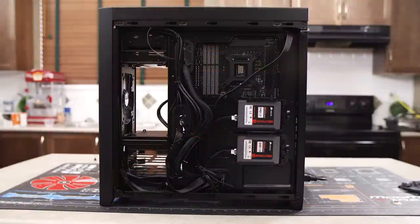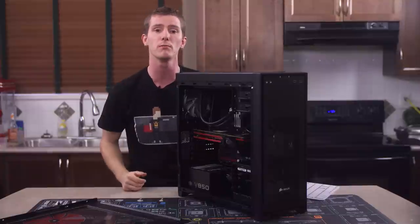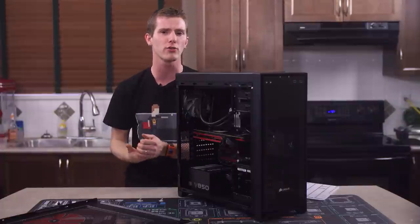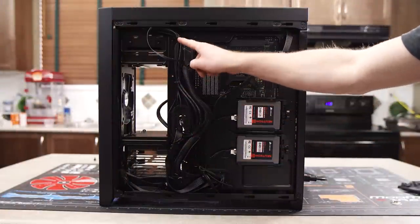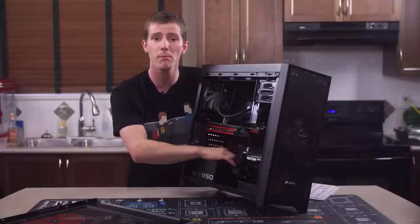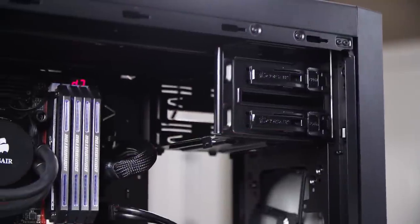Cable management is a good point for this case - there is ample room in the back for the 24-pin and other bulky connectors, and the included cables for the front panel actually come pre-managed with zip ties tied in place, so you pretty much don't have to move them. But note that I said cable management is a good point, not a great one. The back of the motherboard tray has only four cable management loops, and when they're basically free to add, I'd like to see a lot more. There's also no way to cleanly route the front panel audio without crossing over at least a few inches of motherboard at the bottom. Most cases have a little spot in the bottom left for that connector, and this feels like an oversight. There's also no room in the top aside from the hole for the 8-pin connector to route smaller stuff like CPU fan cables.